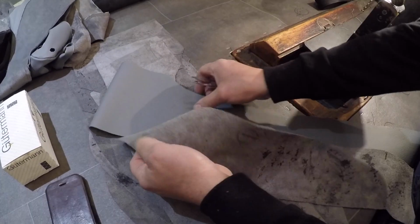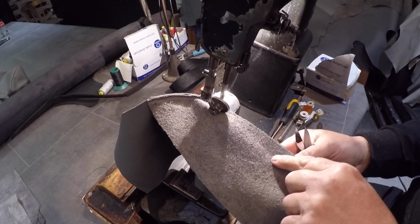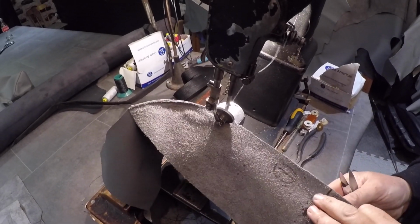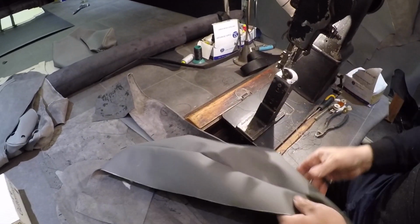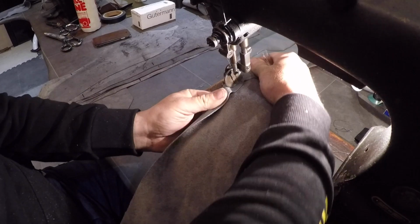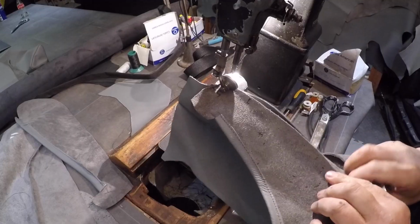So now assembling the back seat backrest bolsters. This seat is made up of 3 bolsters. Each side is made up of 3 pieces of leather, 2 face pieces and 1 side piece. The centre hump is made up of 1 large middle section with 2 left and right pieces. The only difference with the bolster pieces is the 2 end ones. They have a folded over section which will hold a wire to enable neatly attaching the cover.